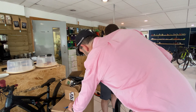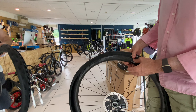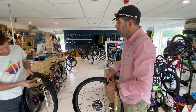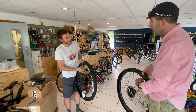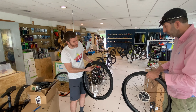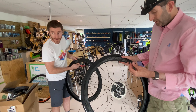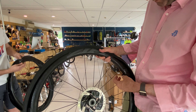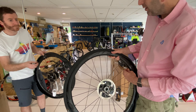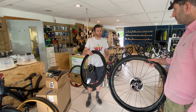Little rubber o-ring on. What's the significance of this rubber ring? It creates a seal both top and bottom. It also helps with carbon wheels — you know how you get that clicking noise — it creates a seal at that point so you won't get that noise. So you've got your o-ring on, then put your black cap on so it just sits over the o-ring and up against the rim. How tight? Just nip it tight with your hands — don't force it. That's phase one done.